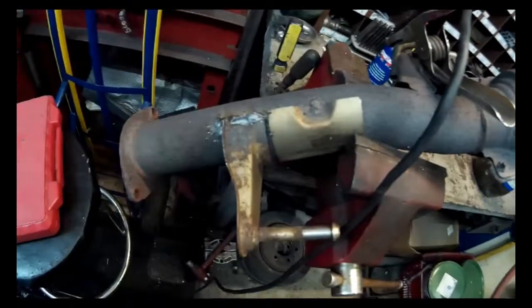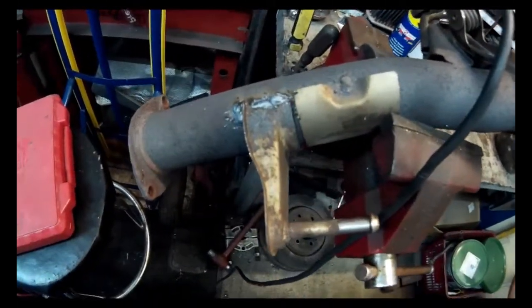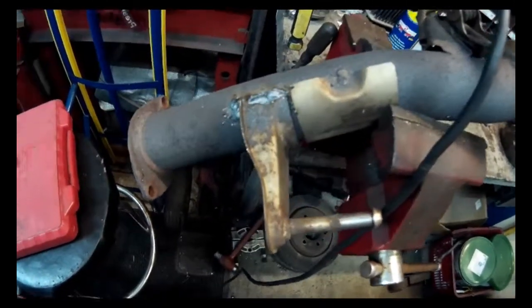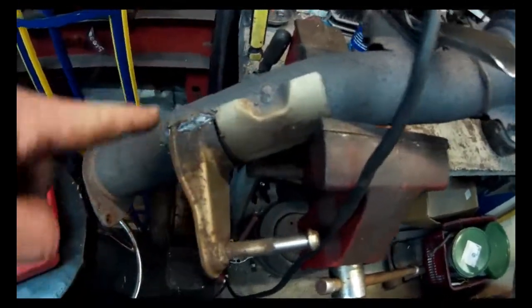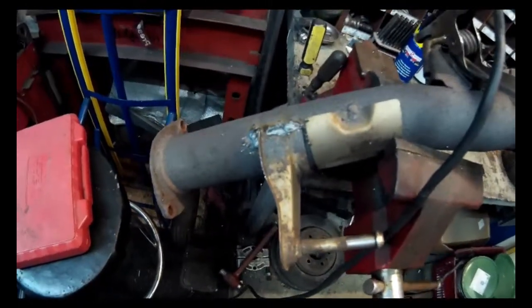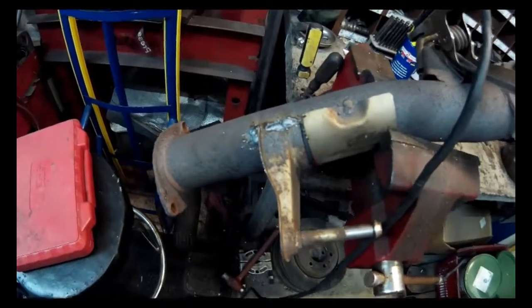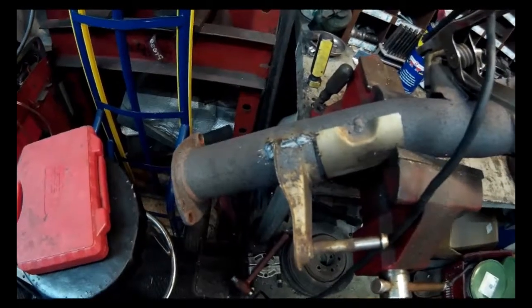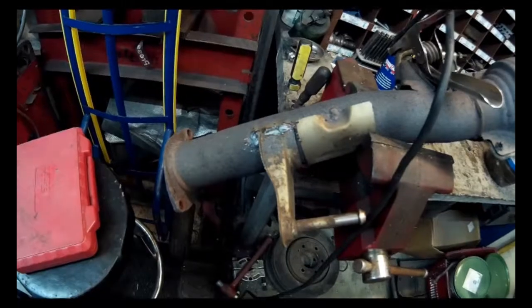Now we'll let it cool down. That's what you should do to fix a catalytic converter pipe. Unfortunately, this one probably should have been replaced because it's just going to rust out again — the metal is so thin where they tack-welded these shields and this bracket onto it. It really should be replaced. If it comes back in leaking, it's definitely going to be replaced. But I thought I was doing the guy a favor by fixing it. The truck is so rusty — who knows how much longer it's going to last. Thanks for watching everybody, please subscribe.